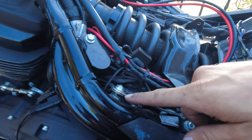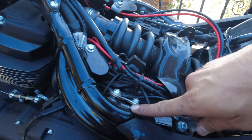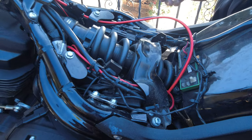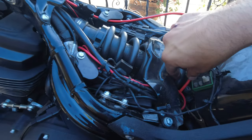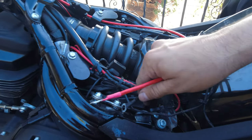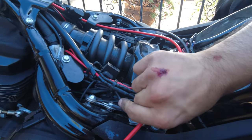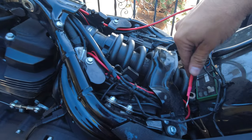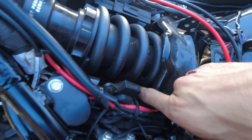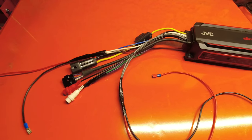You can see where I have my LP6 grounded on the frame. You could ground stuff on the frame or to your battery — it's up to you. I'll probably ground this right here on the frame bolt, just loosen it up, put the eyelet in, and crank it down. Then connect this to the positive — I already have quite a few wires on there. Anyway, let's go ahead and put the fuel tank back on.